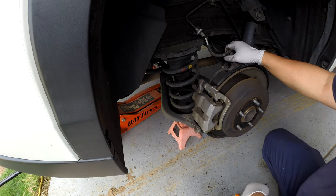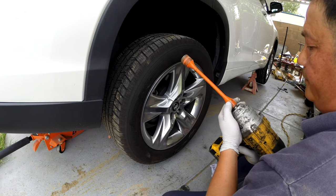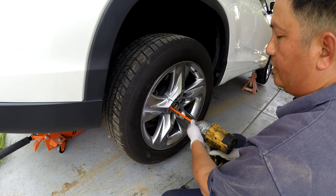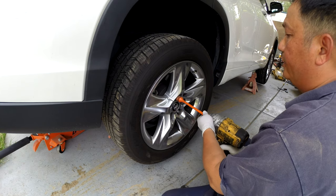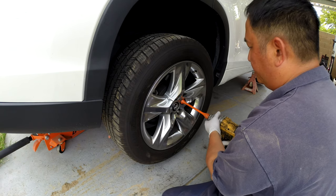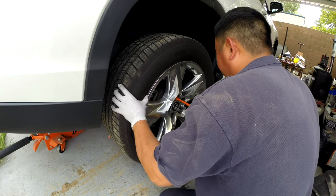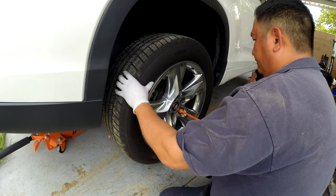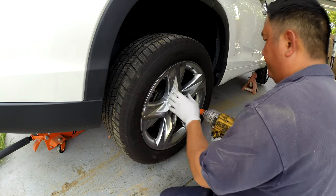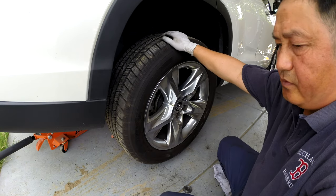That's it — I'm ready to put the tires on. For the lug nuts, I'm using the Toyota standard of 80 foot-pounds of torque. You can do 80 foot-pounds — I always say it shouldn't be more than 100. 80 to 90 should be okay. According to the standard for Toyota it's 80 foot-pounds of torque. Thank you for watching and subscribe — goodbye!